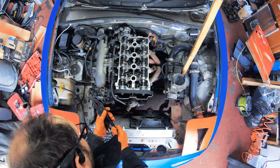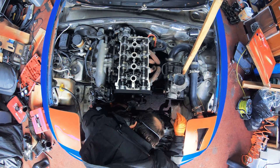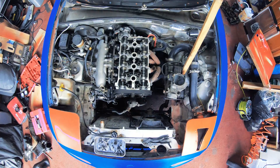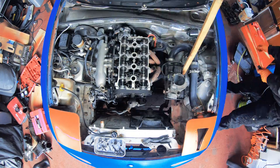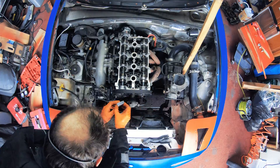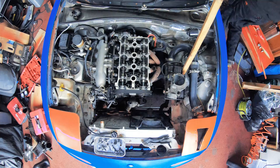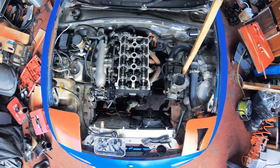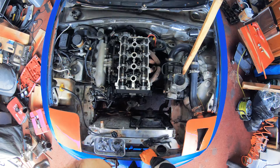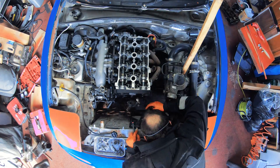This has been on and off the entire time. I've tried to compress the lifters overnight for 24 hours, that hasn't worked. I've run the car up to temperature, revved it in the driveway late at night annoying all the neighbours — none of that has worked. So today we're going to take this off, take the cams off, take the lifters out, swap them to another cylinder and see if that problem follows. Then I'll really know for sure whether I've got to take the head off again, which I'd rather not do but it looks like we might have to.